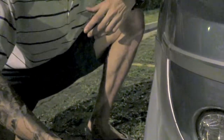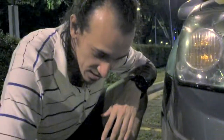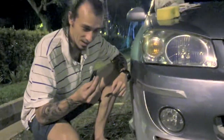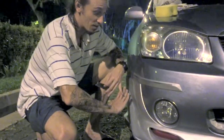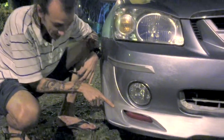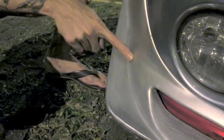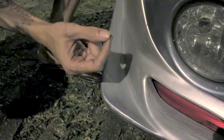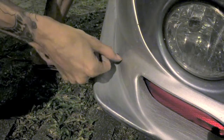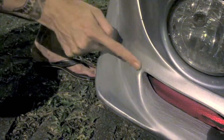For the surrounding area, you switch to medium and then to fine, so that it will be a nice smooth finish. If you use a coarse paper for large general areas like this, you get deep gouges in your paintwork which are very obvious. Even using your finger or fingernail, you can hear the scraping sound because of all the deep cuts.